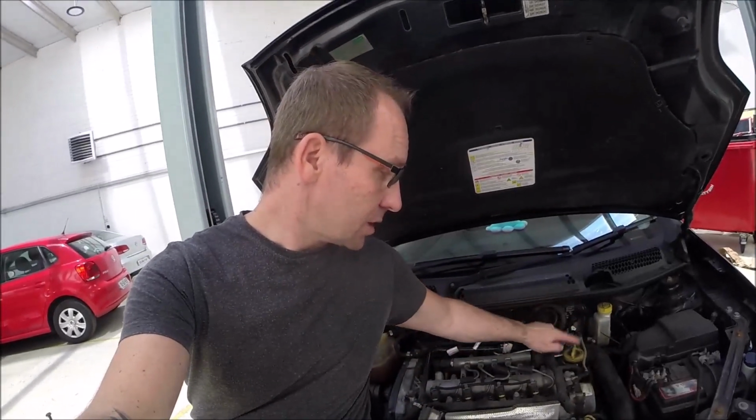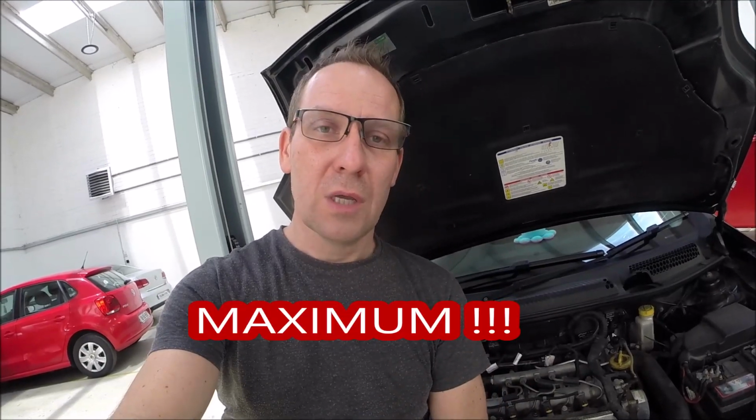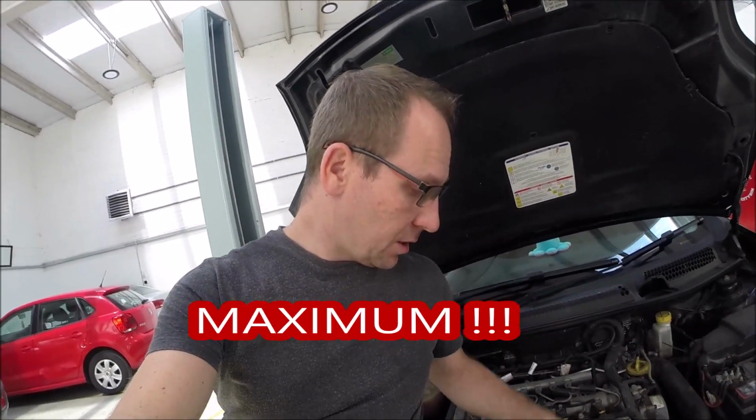All right, so the oil service is done. Don't forget, of course, add the oil here. That was around 4.8, but try fill the 4.6 and check the dipstick. Then start the car and check again, and of course add to the maximum. Will be great if you leave the 2 millimeters below maximum. That will be better for the DPF system, because if the DPF system recognizes too high oil level, it will stop cleaning your DPF.